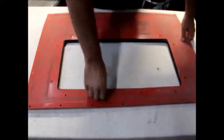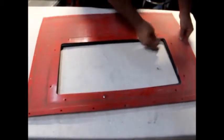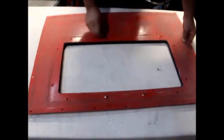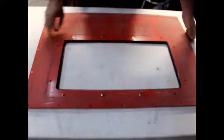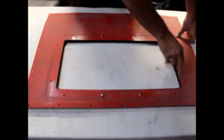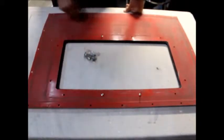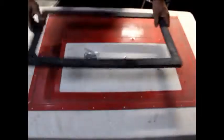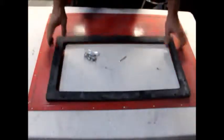I've already done that on this by putting a 3/16th rivet in here and lining it up — I can only get three holes to line up perfectly, and it's the three I've marked here. I've marked black marks all the way around. If I take a file and file towards the black mark, I'll get that hole as centered as possible. Then when I drill for my riv nuts, which will be stuck inside here when we're all done, that'll be the best possible scenario. The idea is all these stay in here and don't fall out, so I simply unscrew them, set this aside, pull out my piece of glass, put my new piece of glass in, and get back to work.